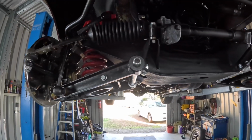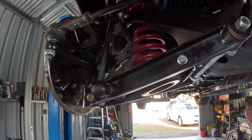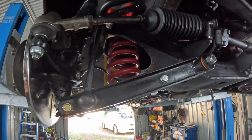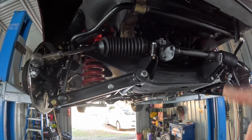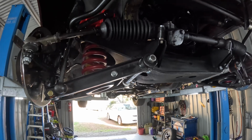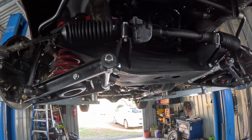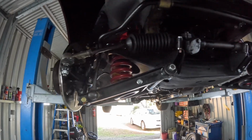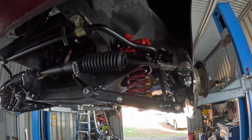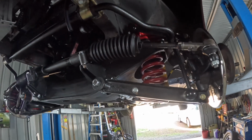And yeah, I did do it before, and I ended up having to take the nuts off the bottom to get access to the front pads on the cross member, and that didn't go well either. So this time I decided I'd put the cross member on and then build to the cross member. And in all honesty, that was easier. I found it easier in my situation with the hoist and things. It was just easy to put it all on and then use the weight of the car